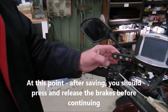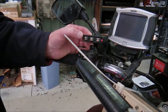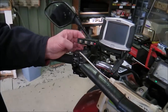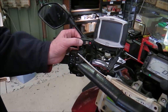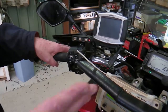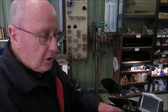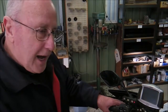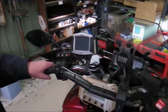We're going to test it now by pressing the set key. One, two — and you can hear that the engine has just started to come off idle on two. Resume has brought it back to idle by pressing it once. So that confirms that the idle position for the cruise control is now at the best position for the cruise to work optimally. If we now turn off the engine on the bike and turn the power off, it will save all those settings.